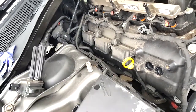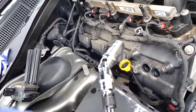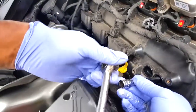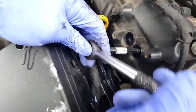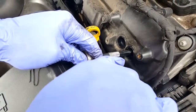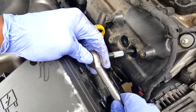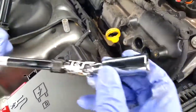You want to get your ratchet with a universal joint on there. Pop it down in there and put your ratchet on the end. You want to pop it until it unlocks and hit it a couple of times. Inside the universal joint there's a little rubber boot, so once you get the socket all the way down, just push down — the rubber boot should grab the spark plug and you bring the whole spark plug out.